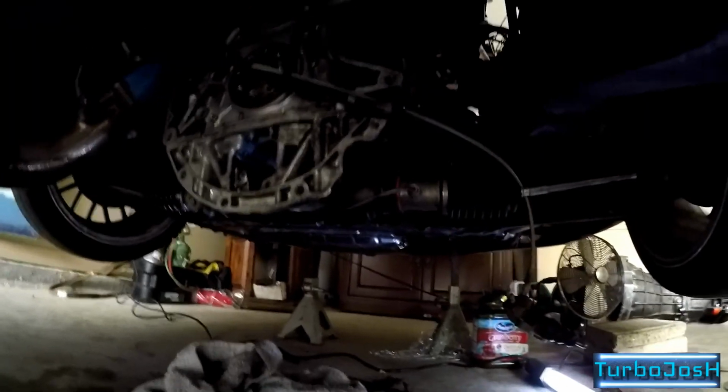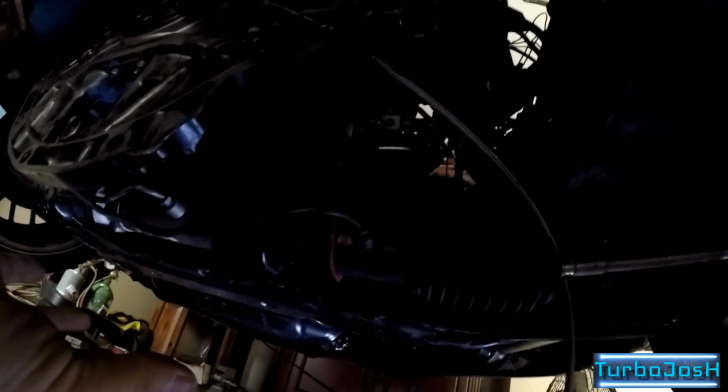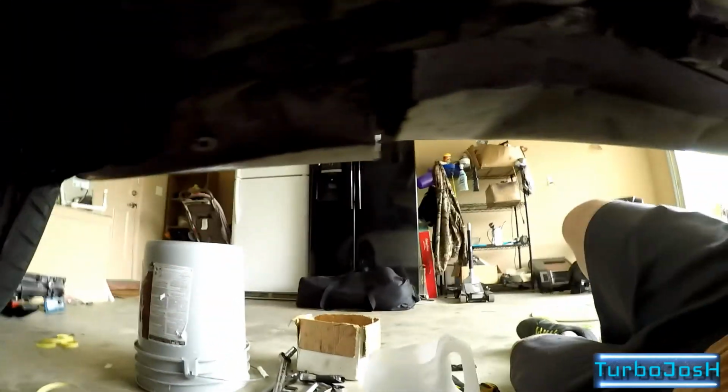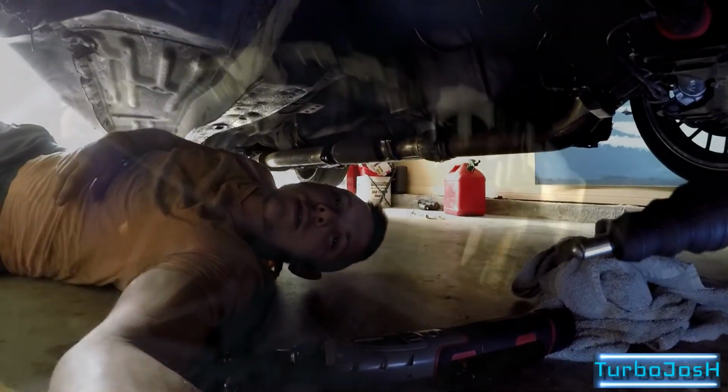I'm going to go ahead and get the bolts out, which go from 1, 2 to the other side, 3, 4, and then 5, 6, etc. outwards, and that's how you get the uppercase off. And the lower pan is actually undone. It's just chilling there, keeping oil in and whatnot. But I'm going to go ahead and get this uppercase separated and redo the gasket, put it back together, and officially have this car back on the road for the first time. I mean, it's been weeks since I drove it last, but at least now it'll be on the road for good. Give me just a second and I'll film a little bit more as I get the process rolling.